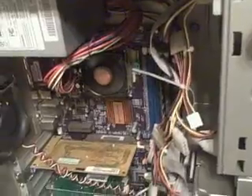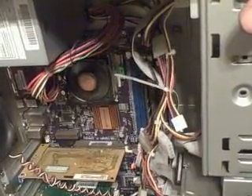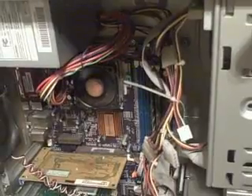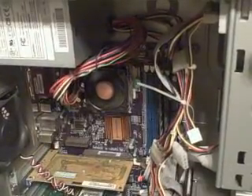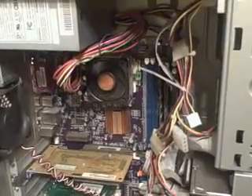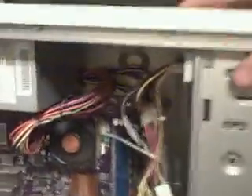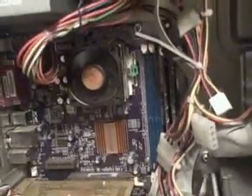It's up and running on the new board. No luck as far as getting it to boot — it froze — so I needed to do a repair install. This board has a different chipset. I had a couple boards that had VIA chipsets just like the original, but they were different model VIAs, so I figured it would probably still not boot. This is the board I wanted to use, so I just went ahead and used it — I don't think it has a VIA chipset, but it doesn't really matter. The repair install is quick and it won't mess with anything.